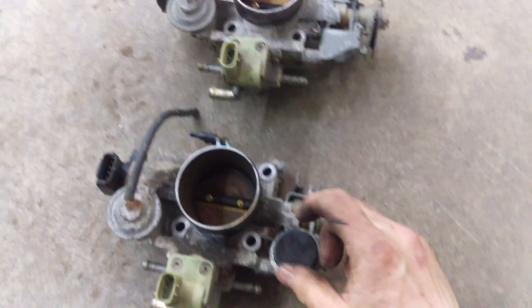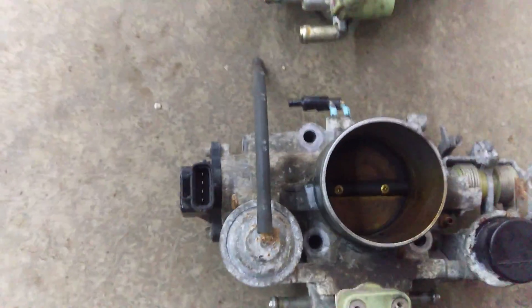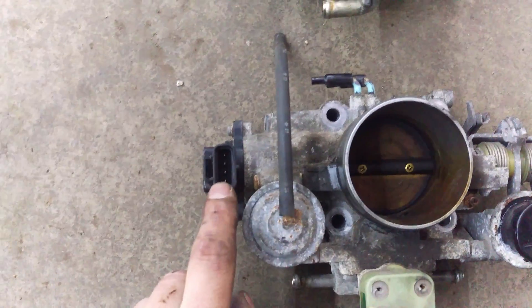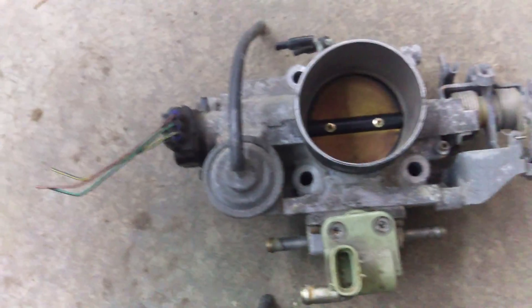You can see this vacuum valve here — it's present on the 96 but missing from the 97. The other difference is the throttle position sensor: the old 96 and older style has four pins because one of them controls idle. The 97/98 just has three pins since it's no longer controlling idle.